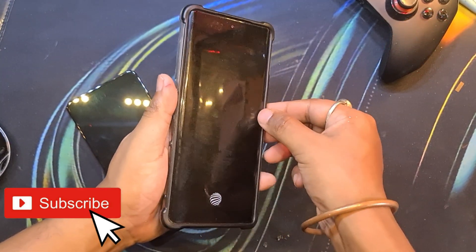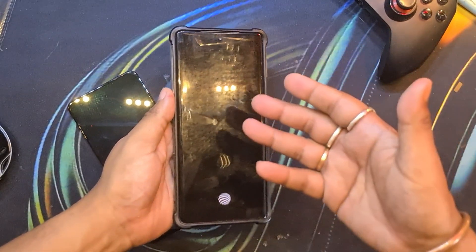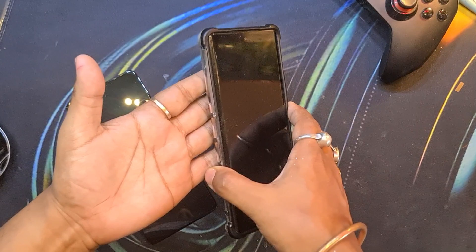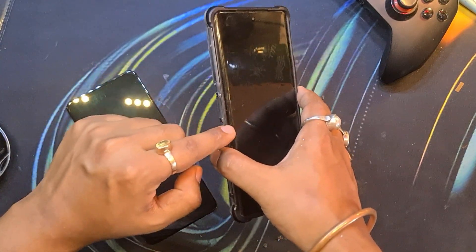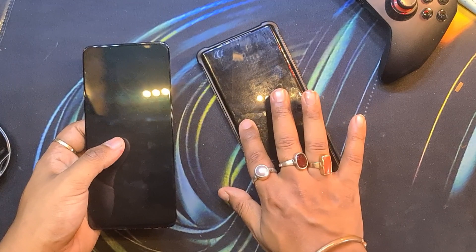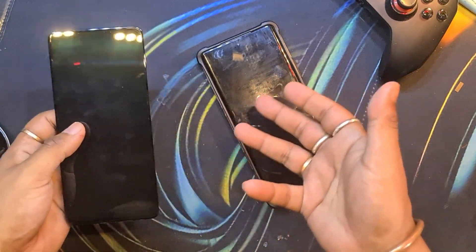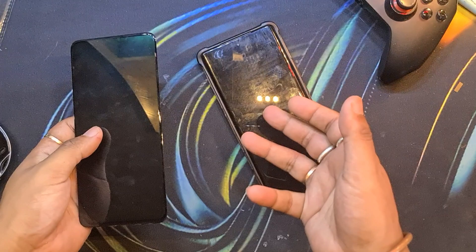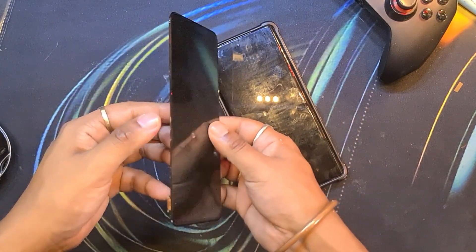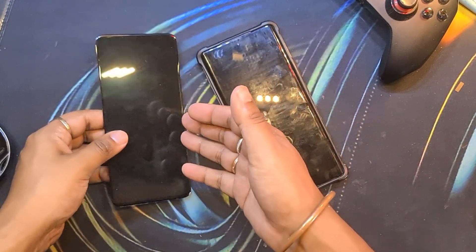Another thing I wanted to mention: if your phone has a curved display like this, which swoops down like in most Samsung phones — though now they're all going for flat displays — you won't be getting a cheap LCD knockoff for a curved display. The curved part cannot be replicated in the LCD itself, as I've found out from the market and talking to many repair technicians. But the Galaxy A80 display is a flat display, as you can see — flat with no curved edges. So I was able to find the knockoff.